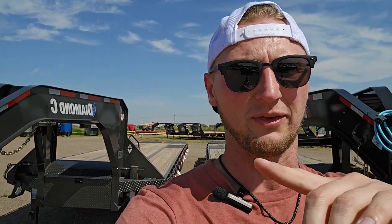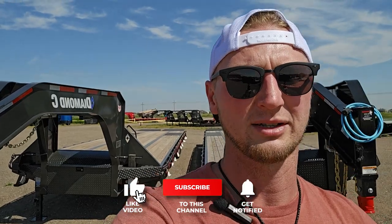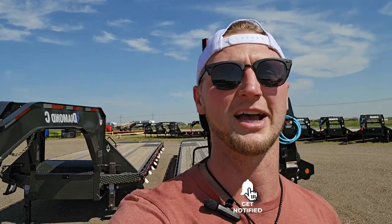We're flexing now. Keep in mind, this frame twisting and frame flexing is something that is completely normal — neither of these trailers is broken or not working correctly. This is something you're always going to see when pulling a trailer down the highway, as it just moves along with the road. One trailer will not flex quite as much as the other. The Diamond C has the engineered 16-inch I-beam and the PJ is on a structural steel 12-inch I-beam, so you can definitely tell how much difference it makes with side-to-side twist going down the road. I hope this helps — let me know if I missed something, thanks for watching, we'll see you guys for the next one.